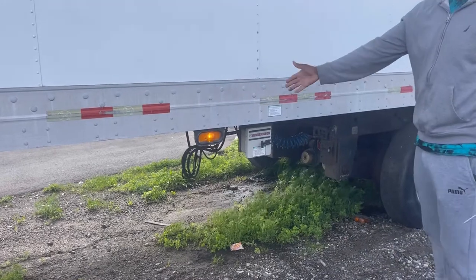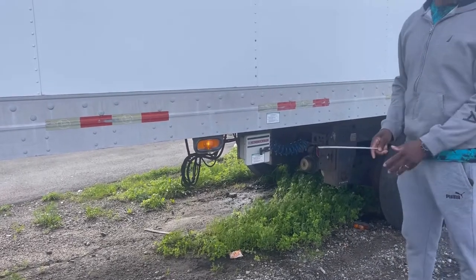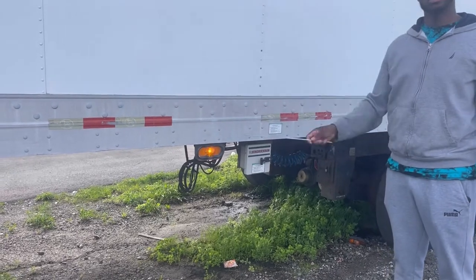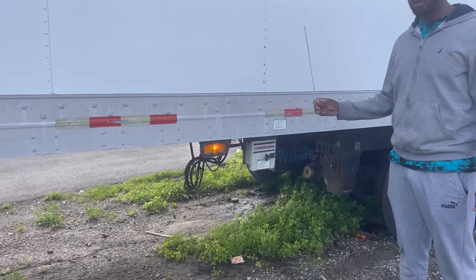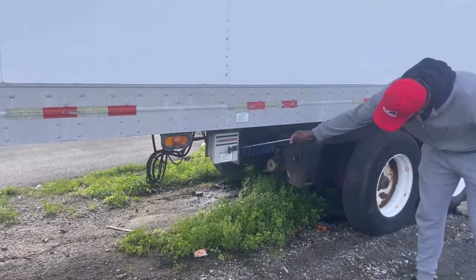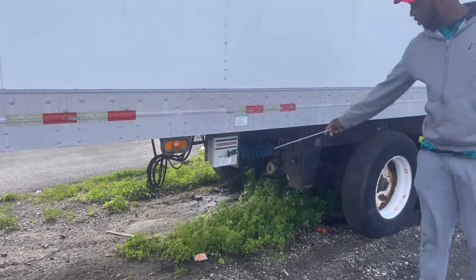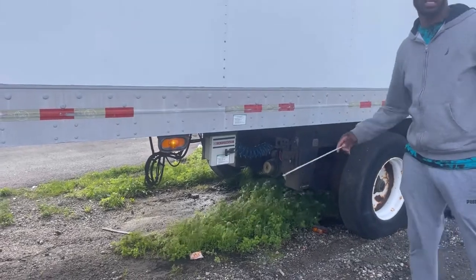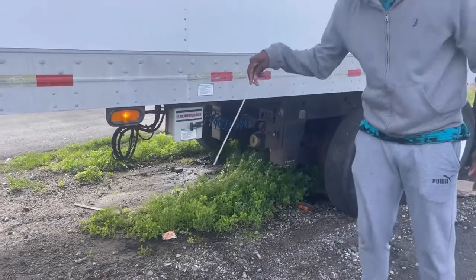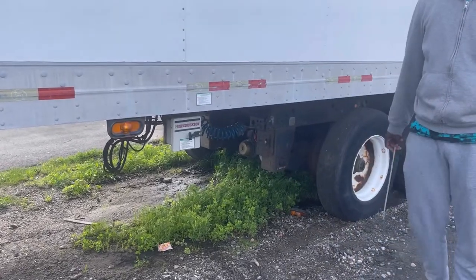This one here, the mid-light trailer. Again, we're going to mention floor joists. They mention it three times: the front, the middle, and the back. Floor joists and the floor. No holes in my trailer floor and no broken joists. My airline, secure, no leaks. No less than 18 inches off the ground.